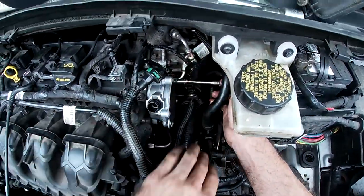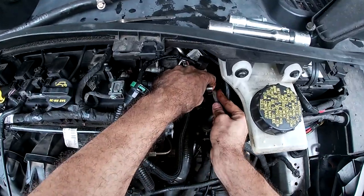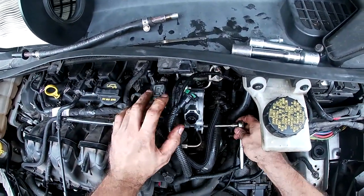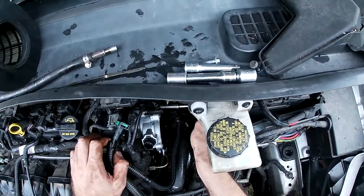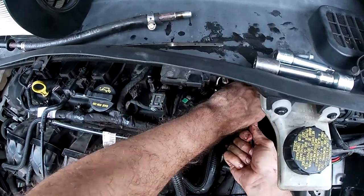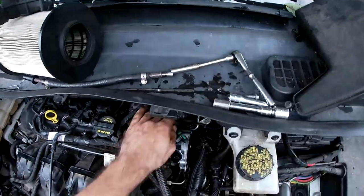You should be able to see everything there. There we go — we've got to screw it in, which is going to take our ratchet. Torque it down a little bit. Go to the bottom bolt, run it in a little — do not tighten yet. Take the top one and run it all the way in, then snug the top one. Come back over to the one on the side and do it the same way — just snug with your hands. These are eight millimeter bolts; they do not need to be tightened extremely tight. Okay, there we go — we are connected.